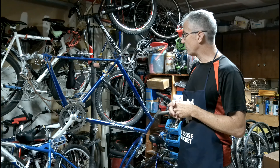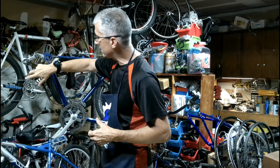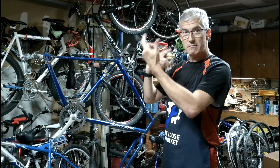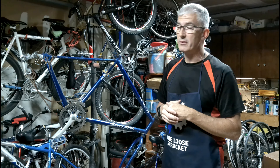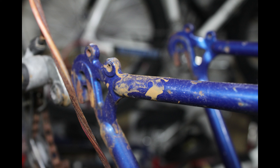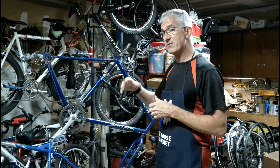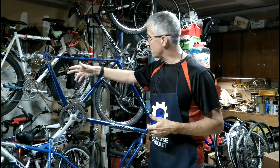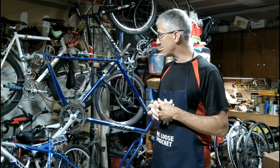Looking at it on first blush, there's no tension at all on the pullback on the derailleurs, so I don't know if it's been flipped around — that happens at times. The chain is rusted, as always — that typically happens. I don't see any major dents, but there's some flash rusting that probably came out from inside the frame itself, because it does have some vent holes. If water gets in there, it has places to escape through the bottom bracket, tube ends, or the head tube.